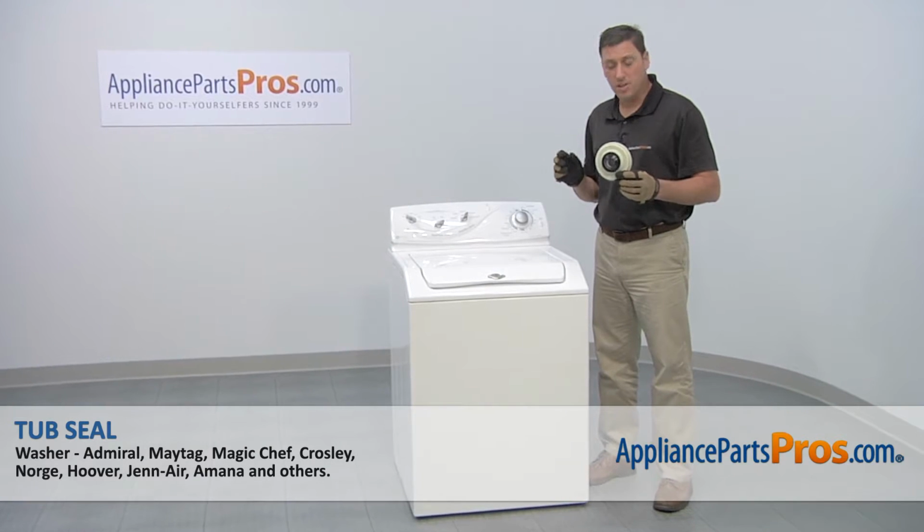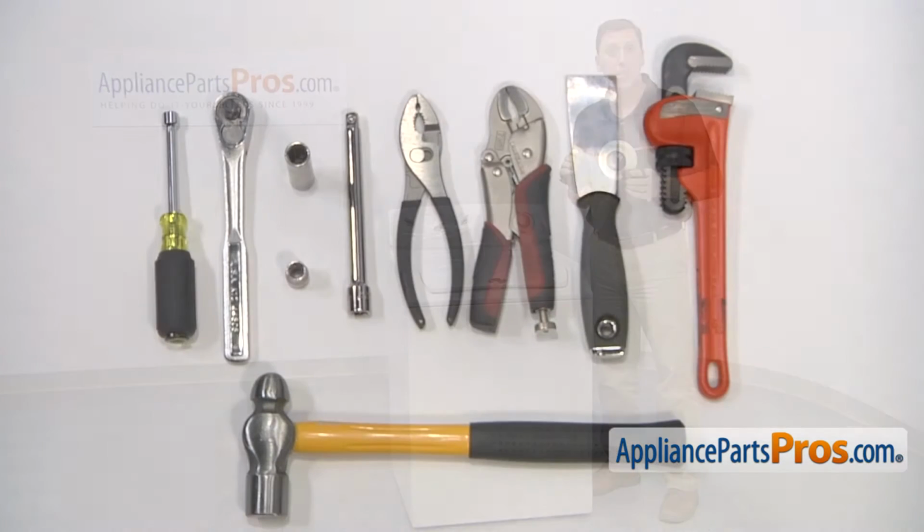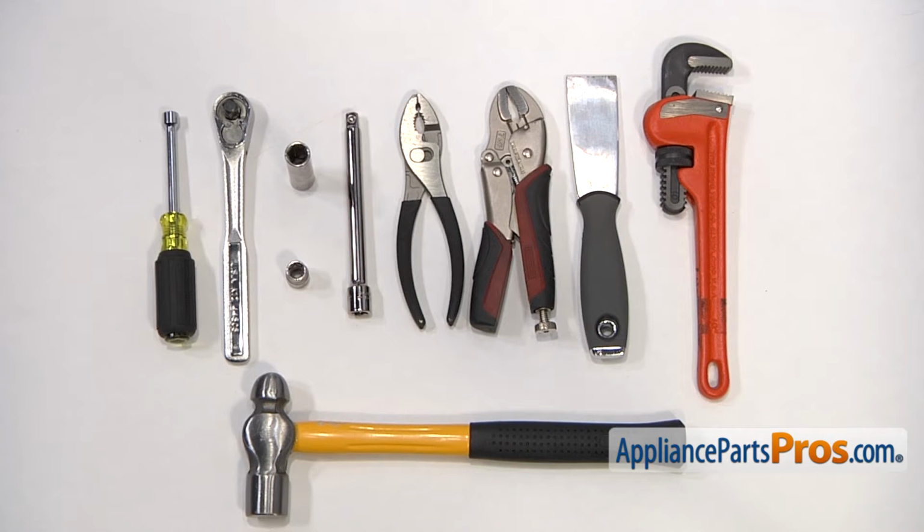We're going to show you how to install a new tub seal kit for your Maytag washer. It's an easy job that only requires a 5/16" nut driver, a ratchet with 3/8" and 1/2" sockets, an extension, a pair of pliers, a pair of locking pliers, a putty knife, a pipe wrench, and a hammer.